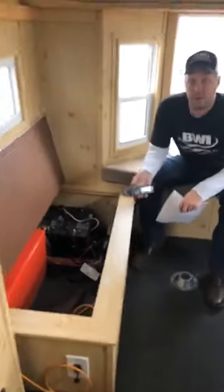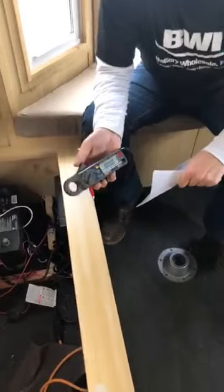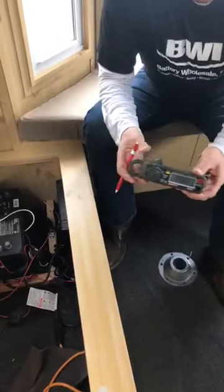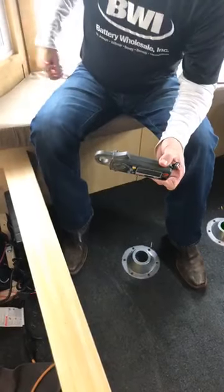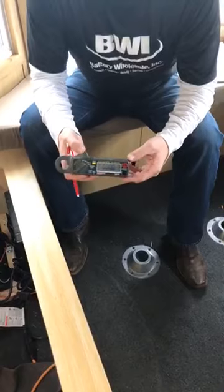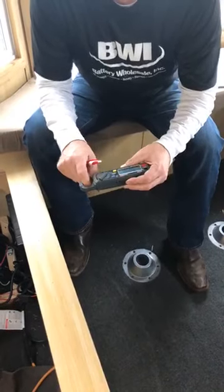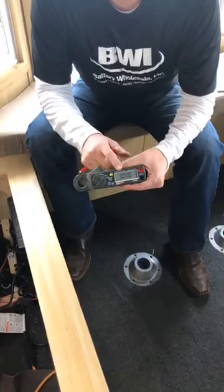What you do is you just clip it around the positive cable coming out of the battery, and it'll tell you what the amps are flowing out of the battery. This is what a lot of garages use if you have a power drain in your vehicle. You'll come in to, let's say, an auto mechanic, and you say, my battery's bad. Nope, we test the battery, it's good. Test your alternator, it's good. It basically means you've got some sort of draw on the vehicle. So they'll put this around the positive cable and then start pulling fuses until they can see the amps drop down.